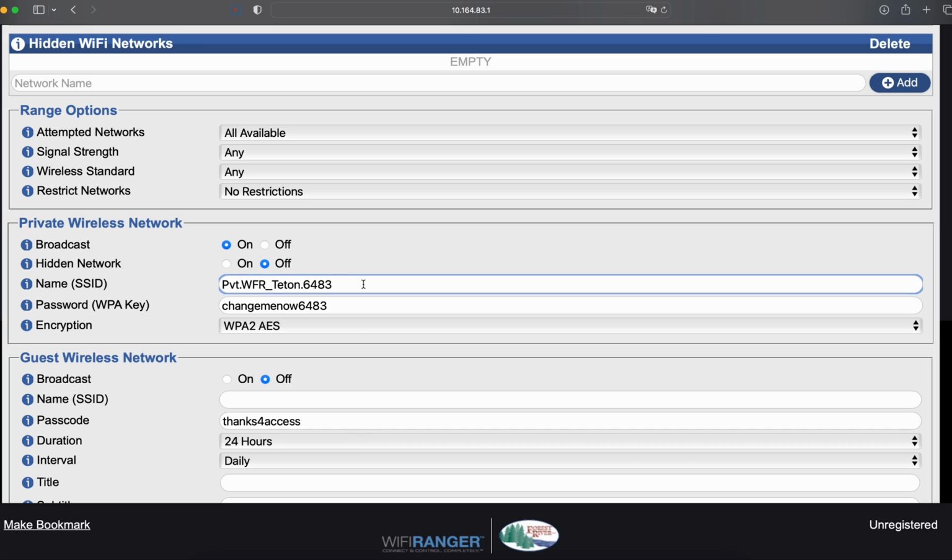So the first thing we're going to do is create an SSID. And what do you want that to be, Tony? We'll call it TNT's Wi-Fi. Wow, TNT's Wi-Fi. Okay. And then the password, we'll make it something fantastic. Do not do something like this for real, we're just doing it for this. But we're going to make it a good password. I would recommend something that's 10 characters or better. Throw in some special characters and whatever.